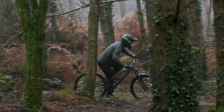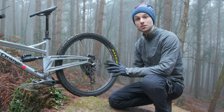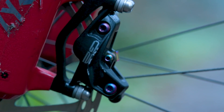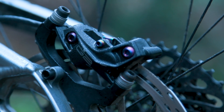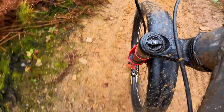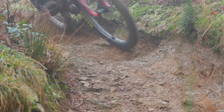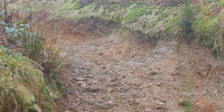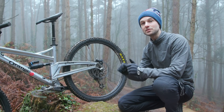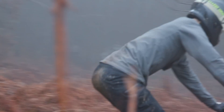The SRAM G2 brake has a four piston caliper where two out of those four pistons are smaller than the others. The two smaller pistons contact the pads first as you pull the brake lever, making the pads contact the disc at a slight angle. This angle helps reduce brake noise and increases modulation — that's how controllable a brake's power is. When you pull the lever, instead of the brakes locking up instantly, modulation lets you control how much force the pads put on the disc, making it much easier to control braking force. It's worth remembering that a brake with more power will always need more modulation.